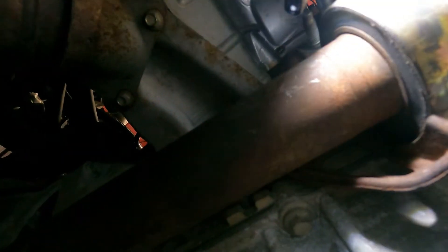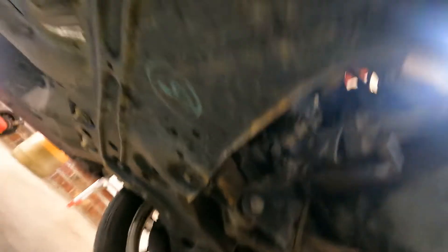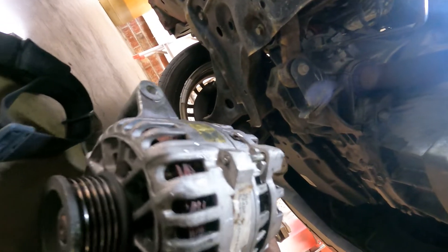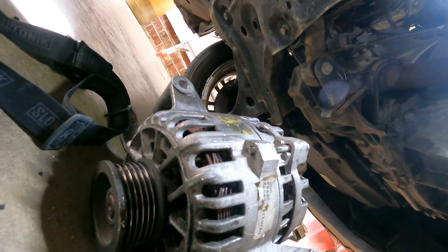Alright, so the alternator is out and that was quite cumbersome, but here's something that helped. There's a bearing right over here on the axle and this is a mount that holds it in place — these are 13 millimeter bolts. I took off the bracket that mounts it to the frame, there are two up here and one right behind it. That allowed me to get some wiggle room — the axle flexed a little more back and forth — and that allowed me to wedge the alternator out. I've actually done it without removing that, but if you're stuck, that's the best way. So this alternator is out, let's compare it to the new one.